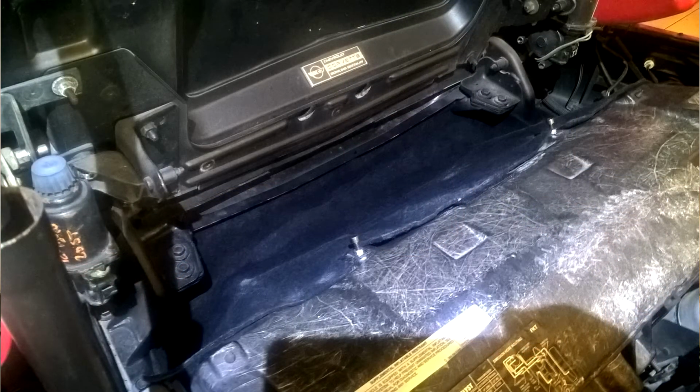So you open that up, and in this next picture you'll see what looks like a black blanket on there. That's actually a carbon filter, which you can buy in strips or rows for little air filters. That's really all it is. It's just a carbon filter that you can cut and add into those little HEPA filters. I bought one in strip form and glued some Velcro straps to it to hold it in place. That still allows air to flow through, versus having the plastic in front completely block it off. It also acts as a pre-filter, which keeps dirt and debris from coming into your car but still allows fresh air to come in.